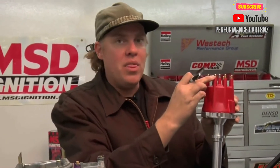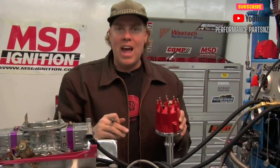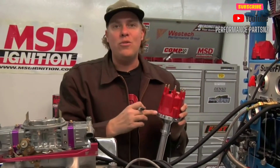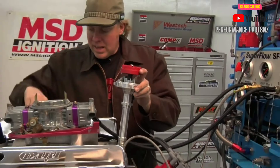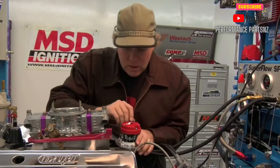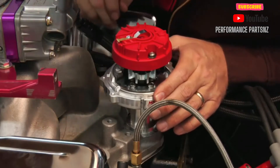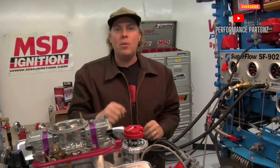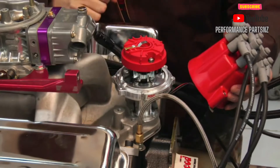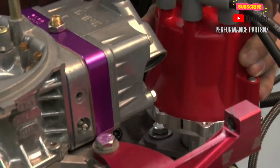To help me do that, I've decided that I want this terminal to be number one and I am marking that location on the housing. The truth is, at this point you can put the number one terminal wherever you want — wherever the distributor will fall in. If you make that number one and then just follow your firing order around the cap, that works. But a lot of guys like to follow the factory manual as far as where number one goes, and that's what I've done here on this Chevy distributor. So once I've got that marked, I can plop the distributor back in the engine. Here's where my rotor is, and I'm going to line that mark on the housing up directly with the rotor. Now I want to get my distributor clamp and clamp the housing in place so that it's exactly lined up and doesn't get messed up while I'm installing my cap and rotor and all the other parts. Now I've got my distributor housing locked down — looking at my mark there on the housing and aligning it with the rotor, I install the cap and sure enough, it all points directly to that number one cylinder.